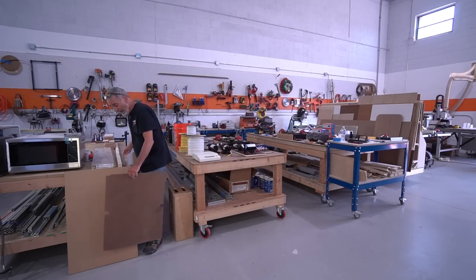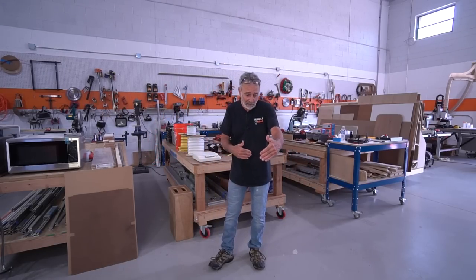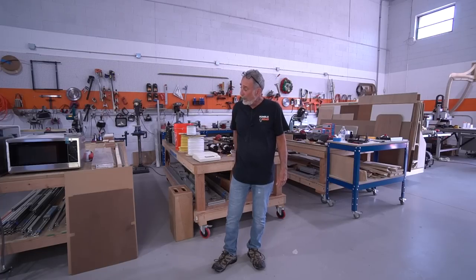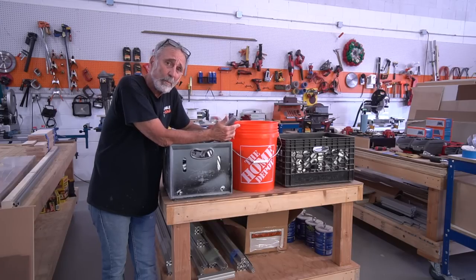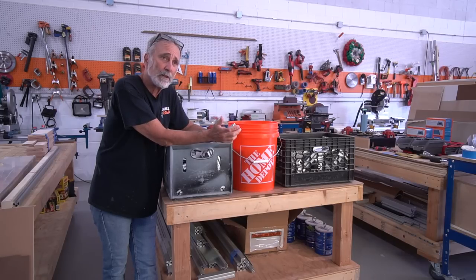I'm going to have to build out an exact galley in plywood box construction and another galley in my 80-20 the way I do them — 18 deep, 60 long, 33 high. That's basically the best galley you're going to get in these bigger vans. I'll build them both out, weigh them, and see what that comes out to. You can see how important it is to pay attention to weight, because there are certain things you'd put in a van build that you don't even consider as weight concerns — but they are, because everything adds up.